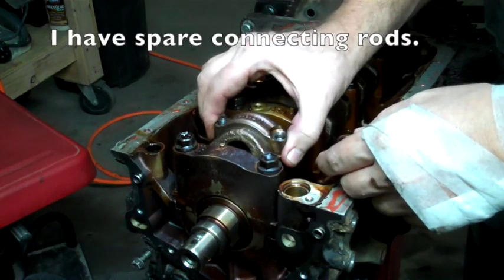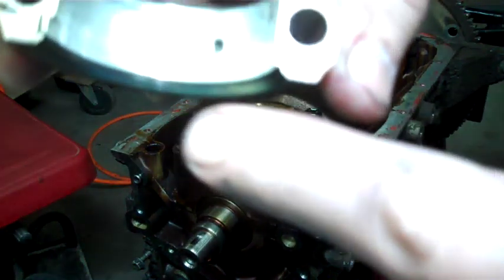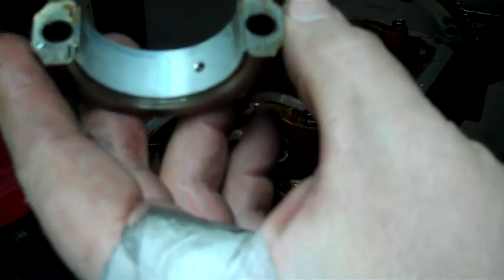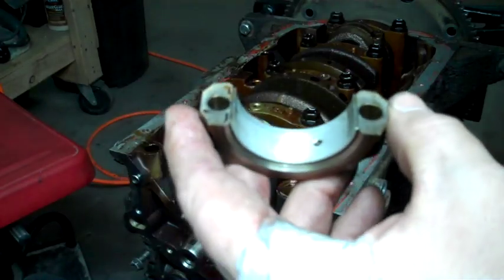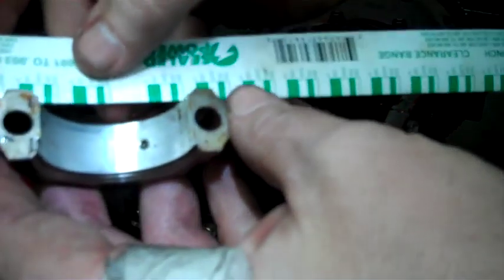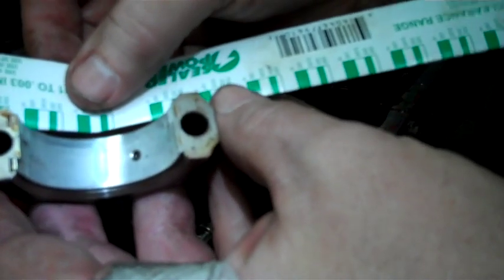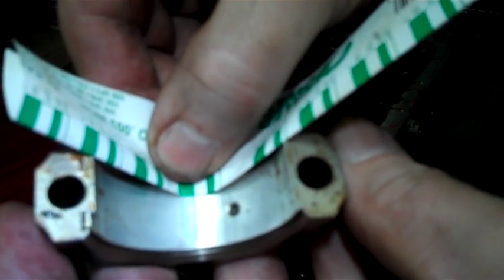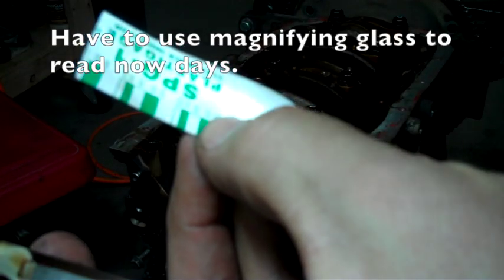Here's the way it's supposed to work — you can see the mark left by the wax inside the cap. Then compare it to the width of the little marks on the gauge. It lines up right there, so this is 0.038 millimeters. Anything between 0.02 and 0.050 is good, and you could also check the width on the gauge itself.